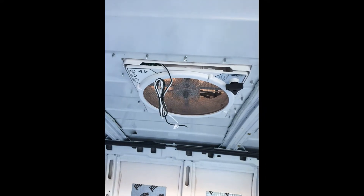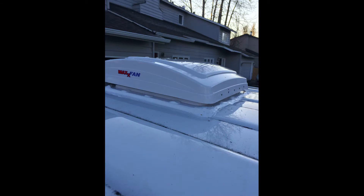Next we did the fan. There is silicone and butyl tape sandwiched between the plastic and the metal of the van. Before installing the screws, I dipped each screw in silicone, then drove them into the van. I used RV roof sealant to seal off the fan, and made sure to caulk over each screw head as well.